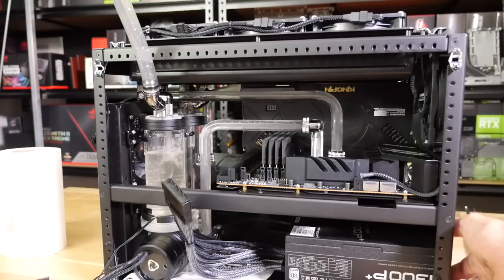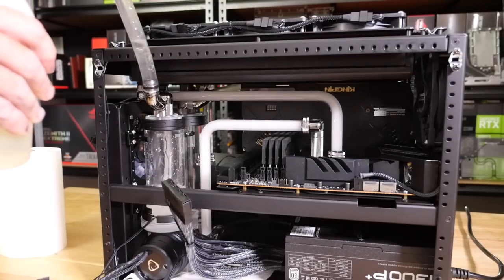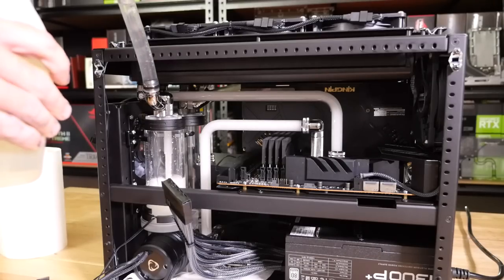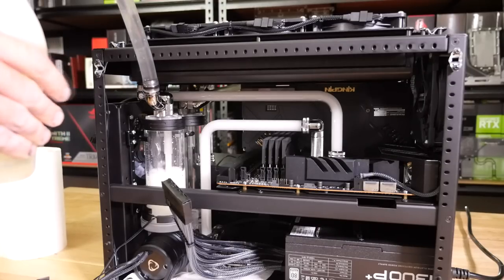And actually, the most difficult tube runs, surprisingly, are the short ones. If you see that connection back from the top 360 millimeter radiator for the CPU loop, connecting back to the top of the res, that is one of the most difficult ones to get. Because if you've got a long distance between two ports, you can do anything with the tube and the fittings. But short distances are extremely limited, and there were quite a few in this build.